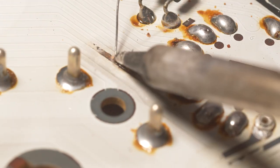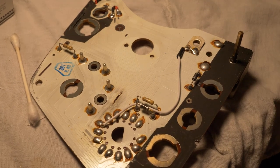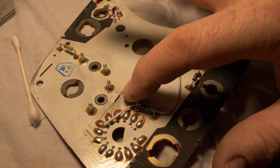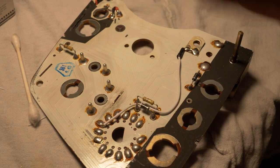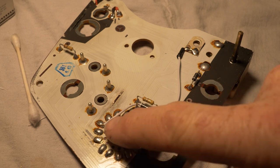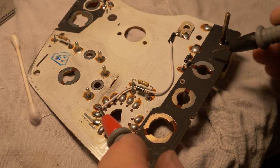What I ended up doing was connecting a lug — an electrical ground connector — designed to bridge from one part of the cluster to another. I bridged that with a wire that went straight to the ground pin of the connector. And finally, at that point I was getting ground continuity all through the gauge, all around the perimeter of the gauge.